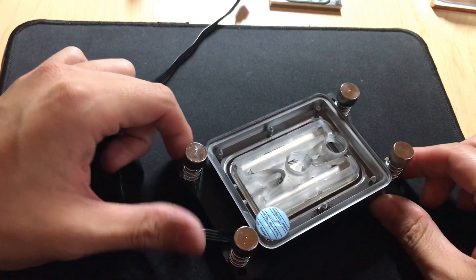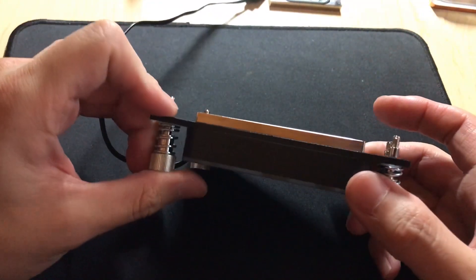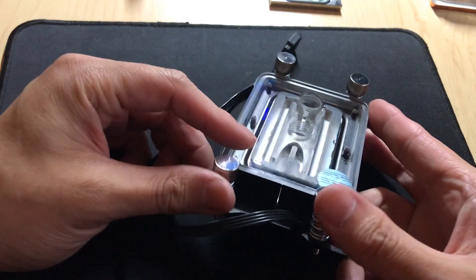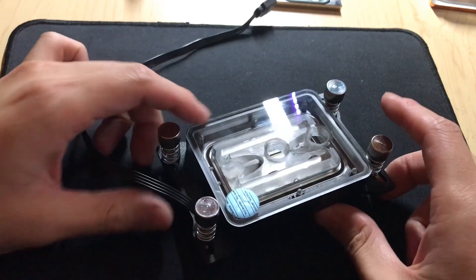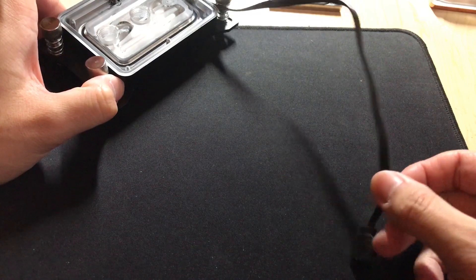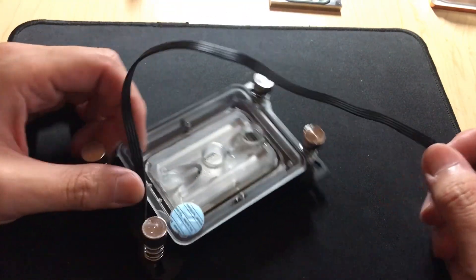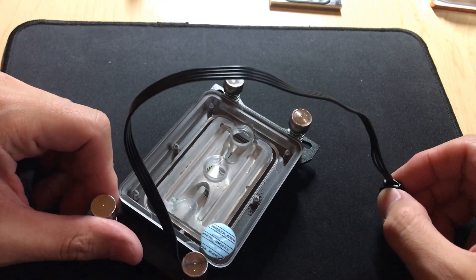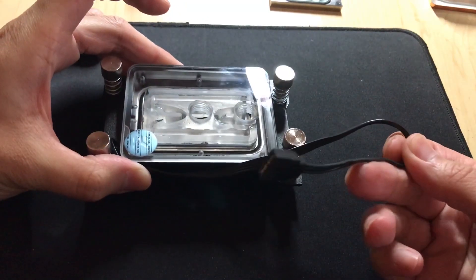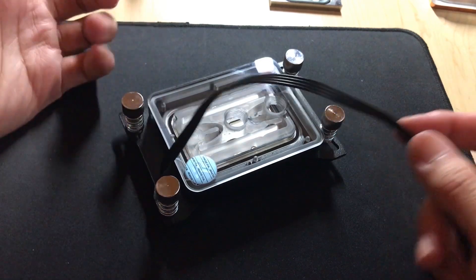The only things I probably don't like about this block: mine has an air seal, but that happens. When installing it, mount the top two screws first — the two narrow ones — it's easier to line up than trying to get the top two to catch after you've already put in the bottom. I'm also not a huge fan of how the wire terminates at the bottom because it's fairly short. Most motherboards — if you have an RGB port at the bottom for X399 — you're not going to reach it and will need an extension. Most X399 boards have an RGB header near the top right by the CPU, and if you wrap the wire around, it ends up being a bit too long in that direction and you end up with the wire sticking out. If you don't care for RGB, you can always get the non-RGB version.